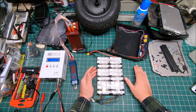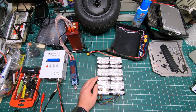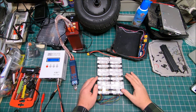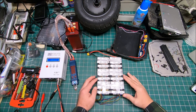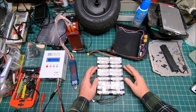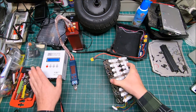According to the numbers, all the cells looked really fine. The battery is 8000 milliamp-hours and averaged around 7500 milliamp-hours, which is 94–95% capacity remaining. That means each cell, when you cycle it — it's two cells per bank — everything looked good.